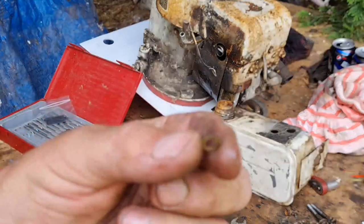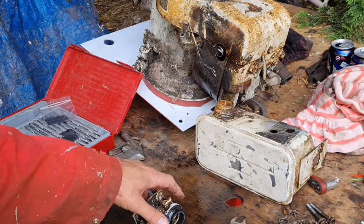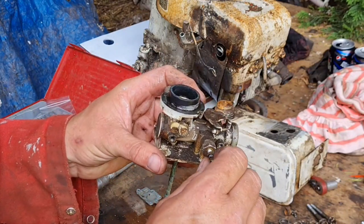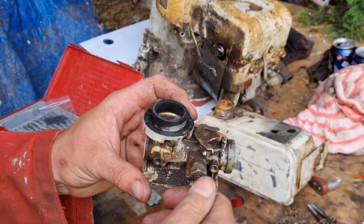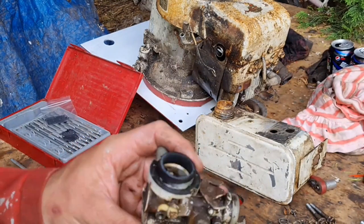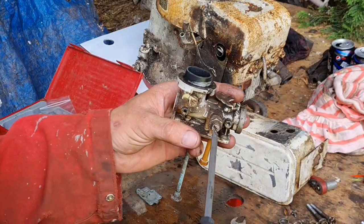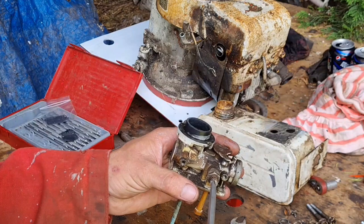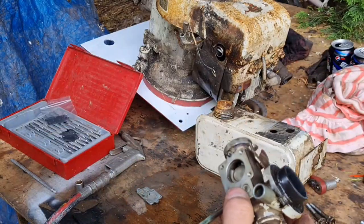It's a little silver, little brass washer on there as well, over that spring. Don't forget that. But carbs are very, very simple. Do not get daunted by carburettors. Honestly, don't. Now, to put these, screw these all the way in, just by hand, you don't have to give them an ooga-dooga with a screwdriver. There, that won't go no further. Undo it, one and a half turns. Oh, let's go 2 turns. There we go. That'll give us a baseline to set this up from. It will start on there, it will run on there.